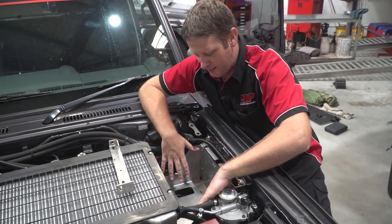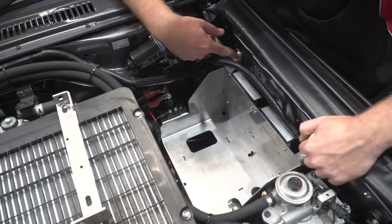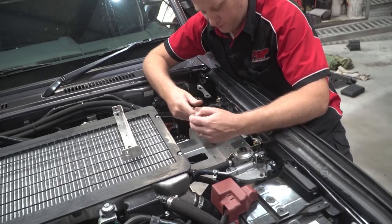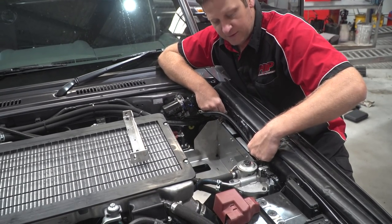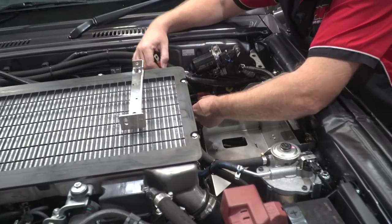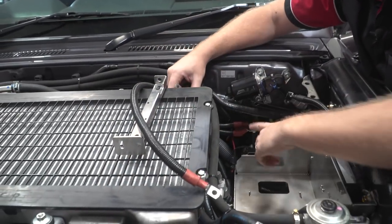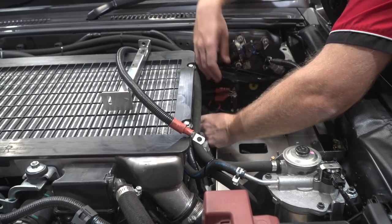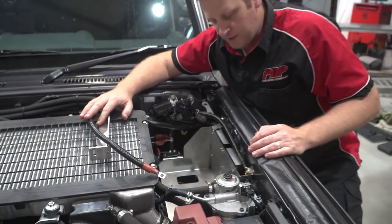We've maneuvered the battery tray into position and lined up the holes. We've started these bolts loosely and put the earth strap on. When you bolt the tray and secure it, you can put your earth onto your battery terminal. You've got two M8s at the front, two M8s at the rear, and two M8s onto the sides - all metric headed bolts. Once the tray's in, secure your solenoid for your battery link and leave the cables out of the way. All your wiring's been run into the cab. Now put some zip ties in, put the battery in, put the J hooks in, and clamp it all down.